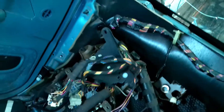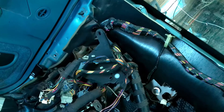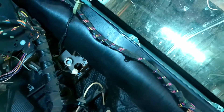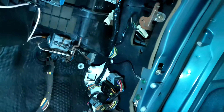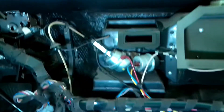I want to get in and show you here — this is just kind of ridiculous. There's still a portion of metal in there, you can see that. That's where the emergency brake hooks up, there's the thing for the pedal — that's probably got to come out of there. It looks like it's got a flat over the top so that'll be okay. We've got all these wires here, and I don't know whether I'm going to take those out or not — I might just disconnect them from the dash side and then pull them, leaving the back side connected so everything that goes back that way will still be connected. That little airbox is going to come out, just in case I don't want to damage it if we have to cut out for the transmission.